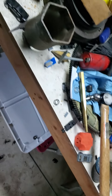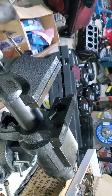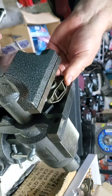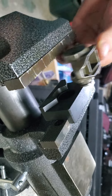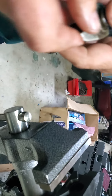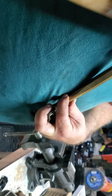The Comp tool kit comes with your bench mount. Take your rocker and lay it on it — my bench isn't even mounted yet, just sitting on a piece of wood — but you just push it down. You can see it pushed level and it's hanging out the other side with the bearing sticking out. I take my ball peen hammer to get it lined up in position, then grab my punch and knock it out.